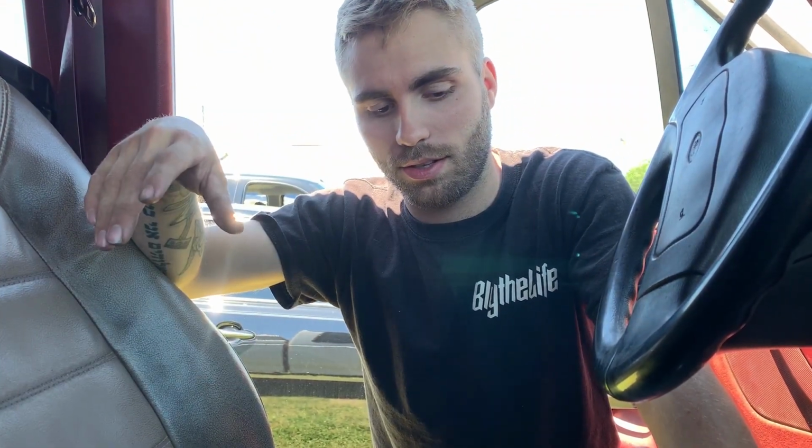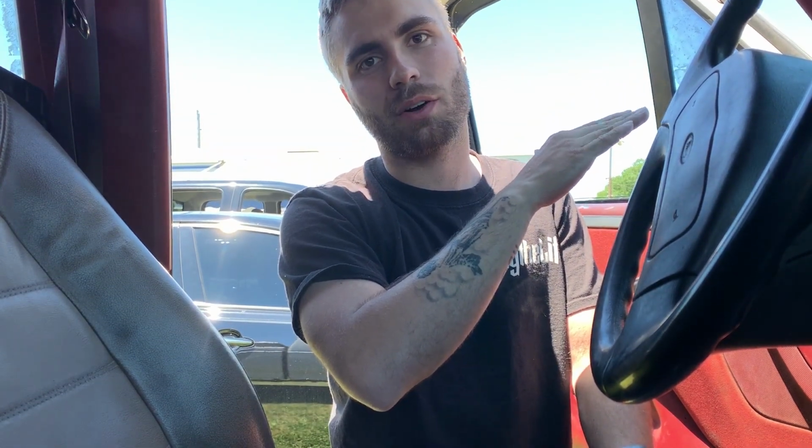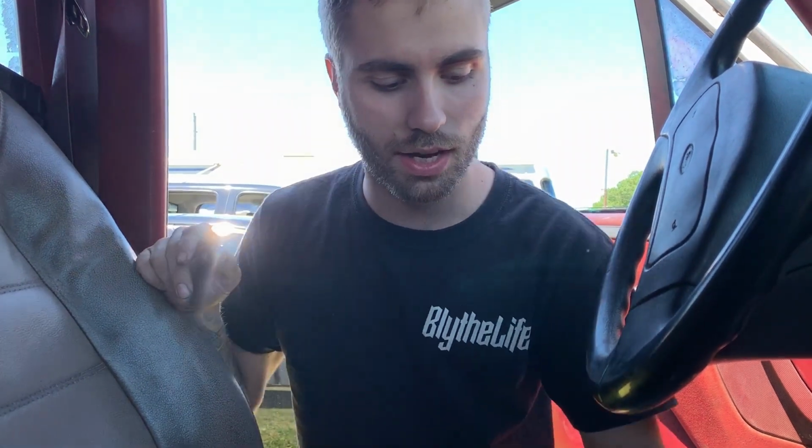So, besides that, the suspension nearly did exactly what I wanted it to. It had a lot of separation, but it separated way too fast. So we're going to set the rebound a little bit tighter, probably 2 clicks tighter on the rebound to slow that separation. Front end, I think it's doing fine. If we can keep that front end down, it'll do. It might do a 160 foot. But if it starts coming up again, I'll probably see how high it goes up. If it only pops up and kind of slowly comes down, stays maybe 6 inches off the ground, a little bit more, that's fine, as long as I'm going straight. But if it wants to keep rising, I have to let out, because if that car gets higher than like a foot, I'm going to mess up my steering control arms.